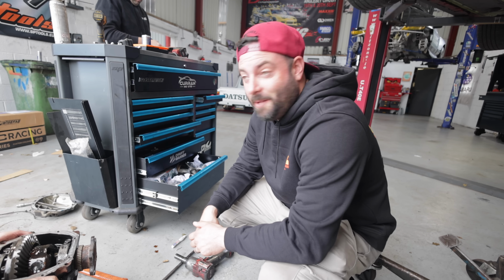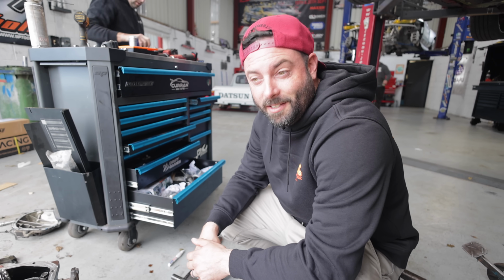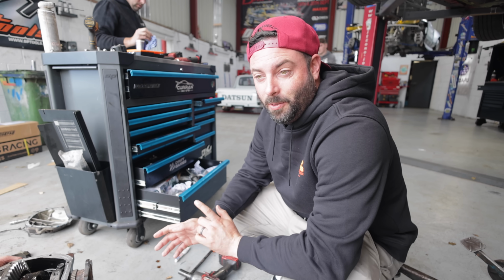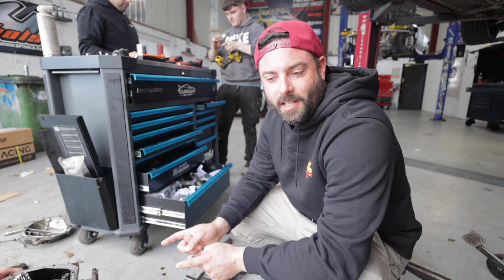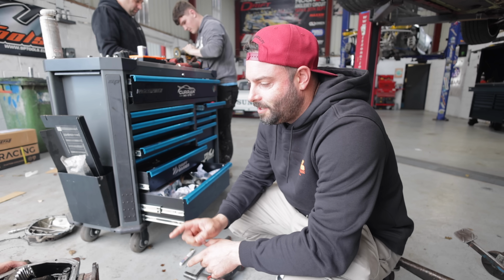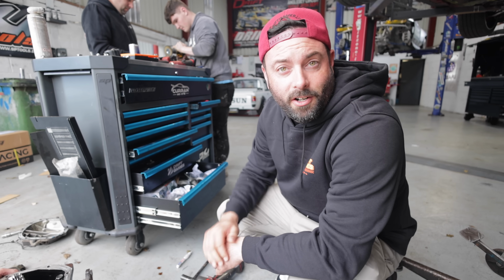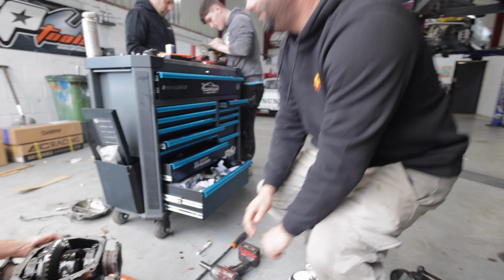So now, Drift Games, breaking ground. No one's ever done that before. So if you have a 400Z, you can basically pull out all the ABS modules, traction control modules, and the car will drift. But the diff is terrible, which is what everyone found, that it wouldn't drift properly. But you can put 350Z internals into a diff housing from a 400Z. You heard it here first. I'm not sure who will ever be in that situation, but if you are, now you know.